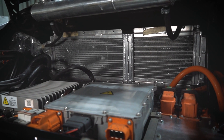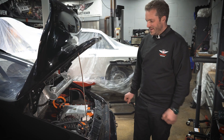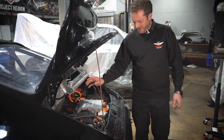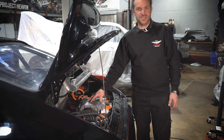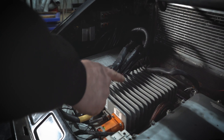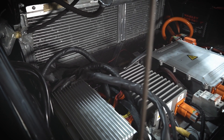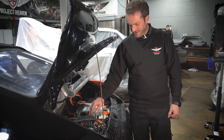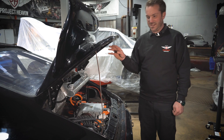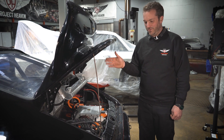Around the back, this isn't completely assembled yet — we're still very much at the test stage but all the componentry is in. We've got the charger unit here — that's for the slow charge off the mains. You've got the DC-DC converter, which is kind of like the alternator; it provides the 12 volts that the rest of the car needs by converting the high voltage DC to low voltage DC. And then there's the BMS — battery management system — which monitors things like battery temperatures and battery voltages. It has a lot of inputs and they all need to be working correctly.